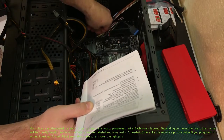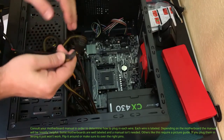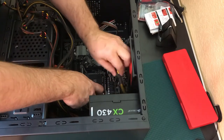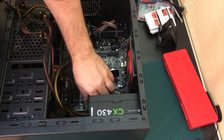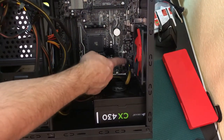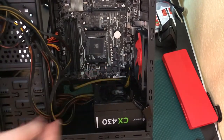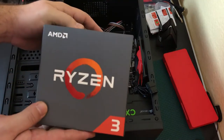We also need an additional 12-volt CPU power connector — it's labeled 'CPU' on the cable. We can use zip-tie points to run it alongside the motherboard and connect it there. We ran the extra CPU power cable alongside the power supply below and zip-tied it — we couldn't go through the other side because the hole in this case was too small.